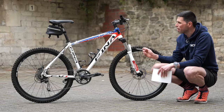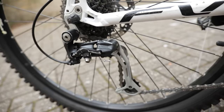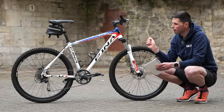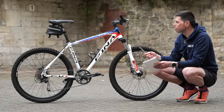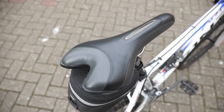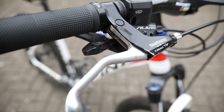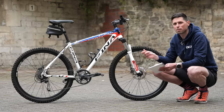Ordinarily it would be a lot easier to fit a mechanical groupset onto this bike — it's set up with all the cable routing and stops on the frame. That would be simple. However, I'm not going to take the simple option. I want to install a Di2 electronic shifting groupset onto the bike, and I'm sure I'll run into some complications, but I'm prepared for the challenge. In terms of handlebars, we're going to run a drop bar — a pro-flared handlebar and a matching stem. Saddle and seatpost, we'll upgrade that too. And we'll run the bike in a one-by setup, which is a great choice for a gravel build and removes any faffing with setting up the front derailleur.